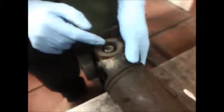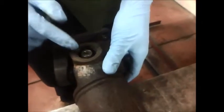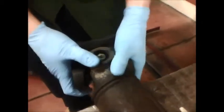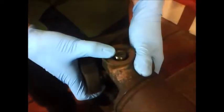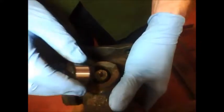Bottom cap is in, so we're ready to install our last cap. Same rules as installing the caps on the yoke. We need to lift the universal joint out of the bottom cap a bit, so that when we slide this last cap on, the universal joint will hold the needle bearings up against the wall.